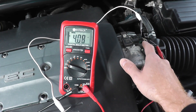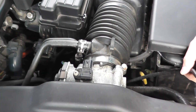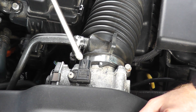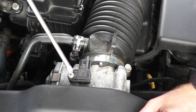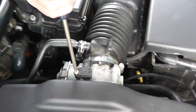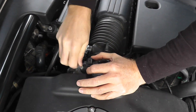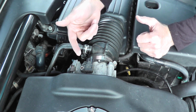Just be careful when you set everything up — you don't want to cross these lines. If you do need to replace the sensor, it's easy enough. On this vehicle it's not too expensive — a new one is roughly $50. We did one on a Subaru last year and it was $300, so they can be quite pricey. On this Acura TL, not too bad. A lot of times these are attached with Phillips-sized fasteners. Get a very good screwdriver — nothing cheap — and press down hard while turning. Put a lot of pressure on it because you don't want to strip it out. Once you remove the fastener, pull the sensor out and replace it with a new one.